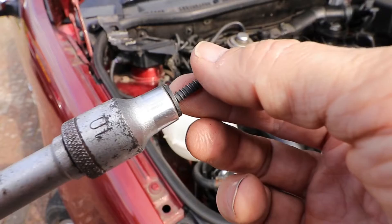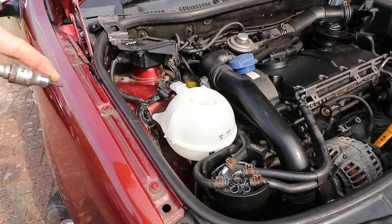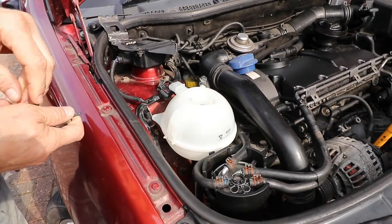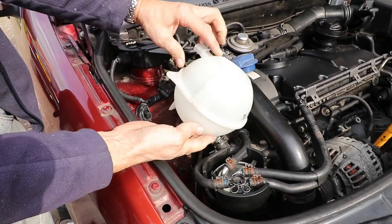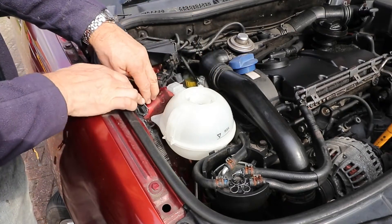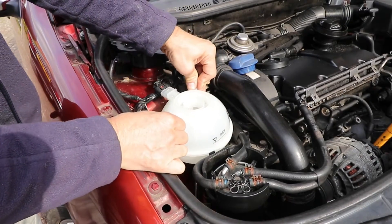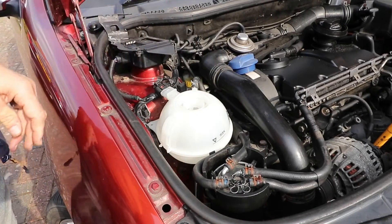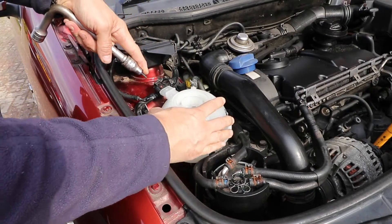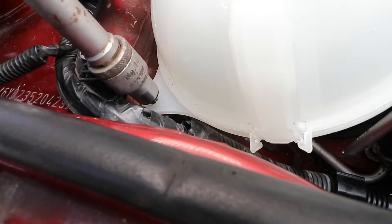Initially I slipped holding onto the quarter inch 10mm socket and it ended up falling down into the engine — I've been unable to retrieve it as it fell down in between the fuel lines, which I'll show you a little bit later in the video. Re-insert the bottom mounting tab into the slot, making sure it seats into place over the plastic inserts. Then holding the double-sided bolt in the socket, reinsert and tighten home, keeping hold of it at all times.